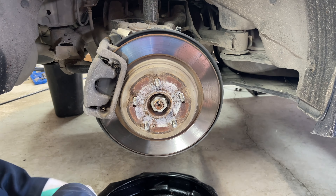The reason the parking brake is engaged is so that when we whack the screw to try to unscrew it, the hub doesn't rotate. Hit it at a 45 degree angle to break the screw loose. It just rotated and now you can take a screwdriver and undo it. You can either save the screw for reuse or just chuck it — it doesn't really matter.